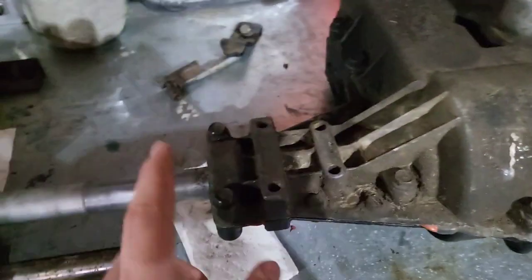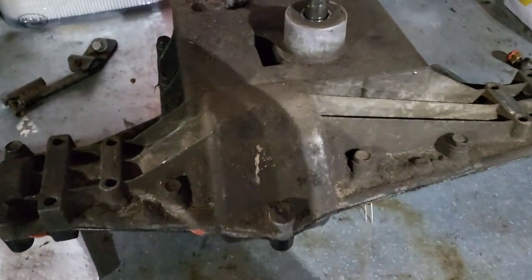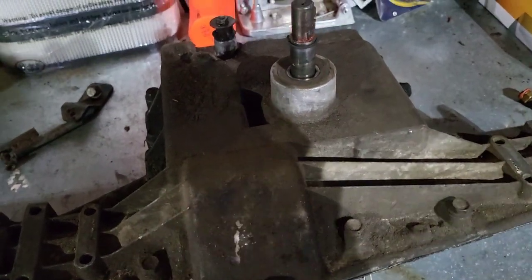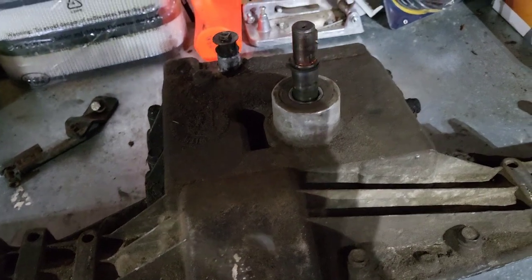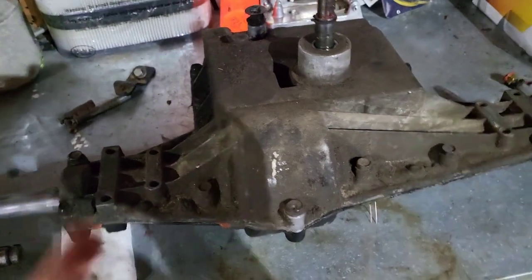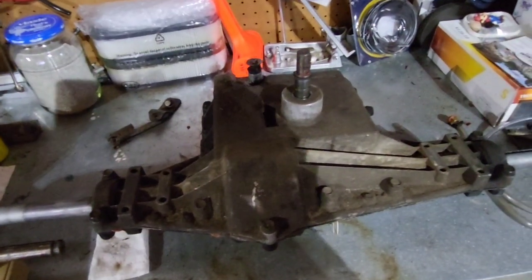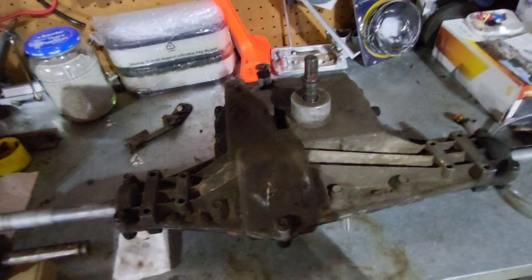That's not the biggest problem. The biggest problem is both these axle bearings leak a tremendous amount of oil — it actually leaked almost half of it out from just sitting for a couple weeks. I actually know why, and I think for all you guys who are on 820s, I believe I figured it out.